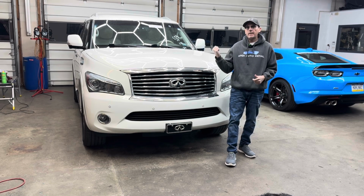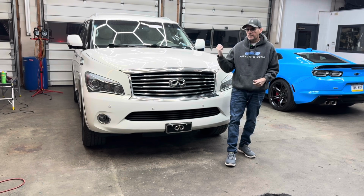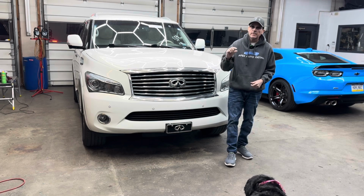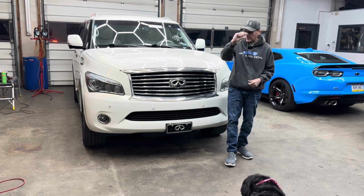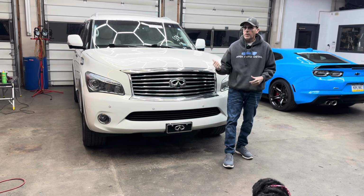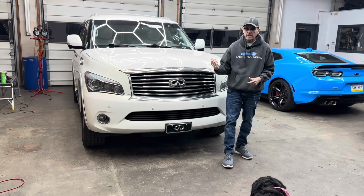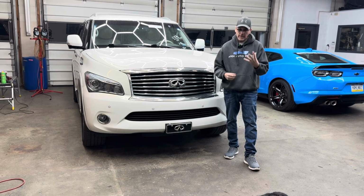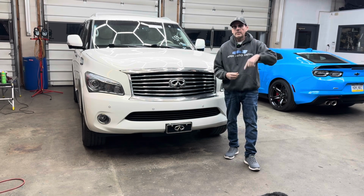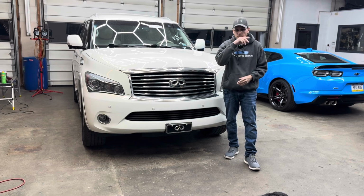This one here had a dead battery, and these here, they're very sensitive. They have 12-volt issues. If the battery isn't fully charged and right in line with the electrical system, it will throw fits. And that's exactly what it was doing for everybody the whole day. I came back to this thing about 3 times. If I find something that catches my attention, looking up and down the pre-auction list, I will do heavy research on the vehicle, each one.